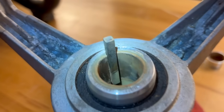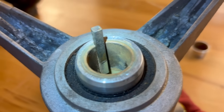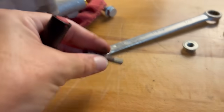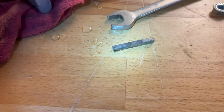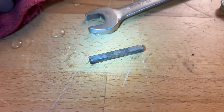When you get a new pump, it should come with a new keyway, so you don't need the old one for that. But you might want to hold on to it if you have a rider, because these keys will also fit in the rear transaxle of your riding mower to keep your tire moving. A lot of people remove their rear tire and it falls out and they don't even know it's there — that's what holds your rim to your axle, a small little key like that.